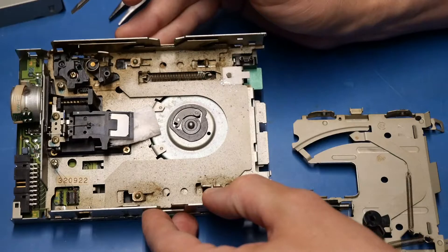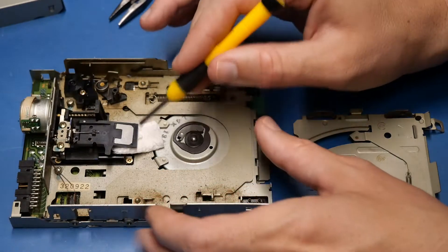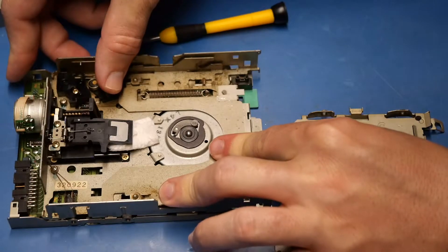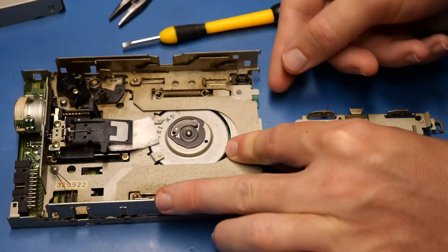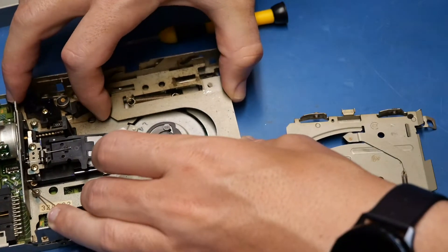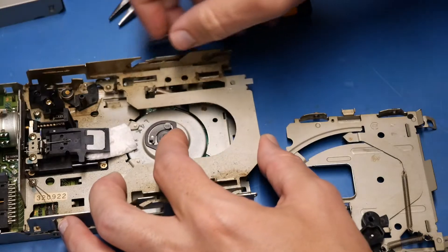You can see how nasty this drive is on the inside — it's in desperate need of a cleaning. For this next part, we need to get this rail to come forward. There are cutouts here, here, and here where these pieces will go through. To release the drive mechanism, we push it forward just a bit, take this tab right here, swing it out, and then let it go back. When you've done that, all of the things line up and it comes out. There's a spring right here that makes it a little fussy, so you take the spring off.